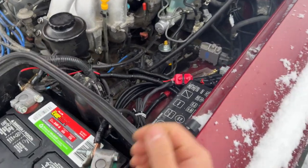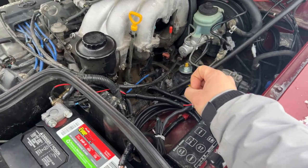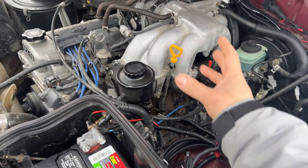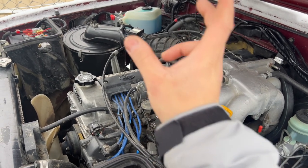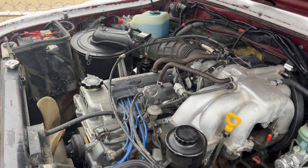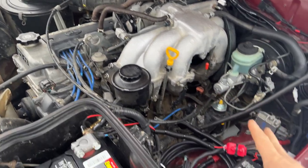Since I have those parts deleted, I have much more room on my intake side. The front differential is located more towards the passenger side, so technically you should put the wire on that side. But I didn't want to put the wires on the passenger side because that's where the exhaust is — I didn't want any of my wires near the exhaust. So that's why I kept it on the intake.